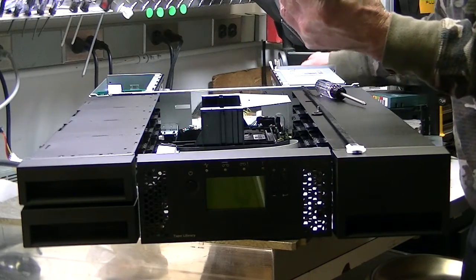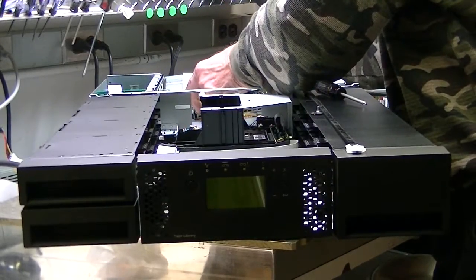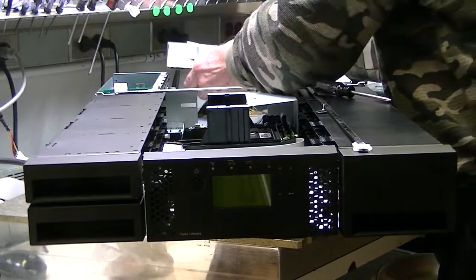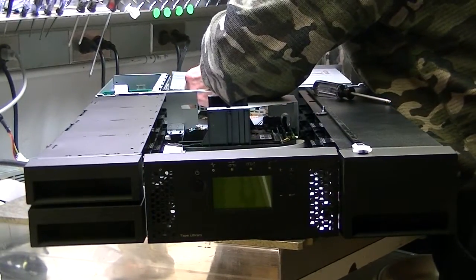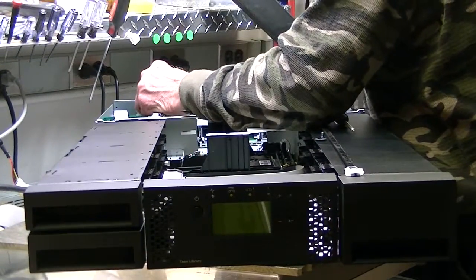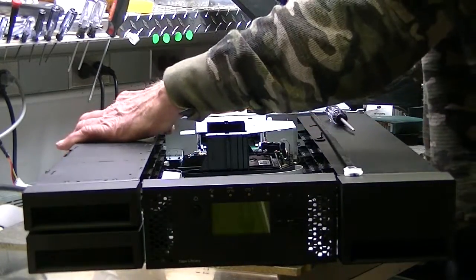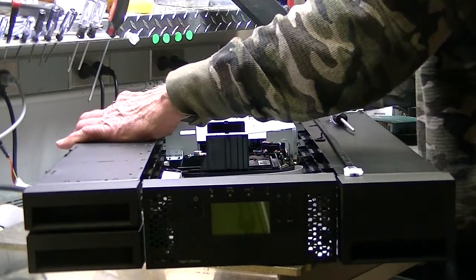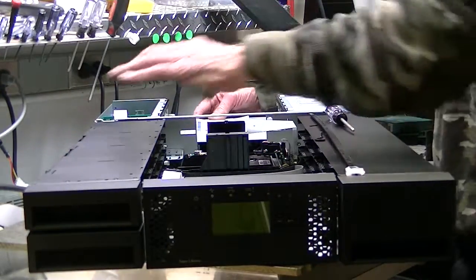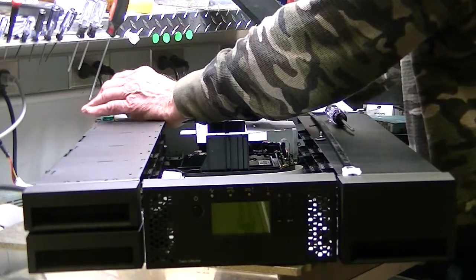When you insert the drive, you just need to make sure there are plastic guide rails on each side. Get it lined up in the plastic rails. It's nice with the cover off so you can see what you're doing. Make sure it slides in and out easily. When you're about a half inch from fully seated, give it just that little push and the drive clicks in place.